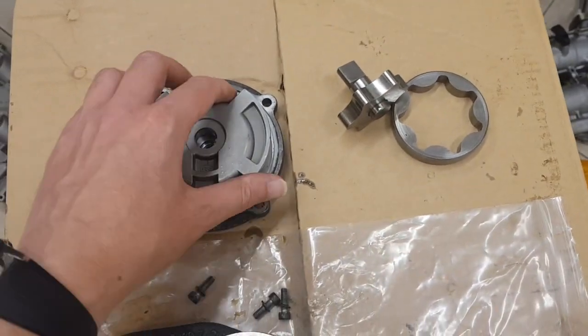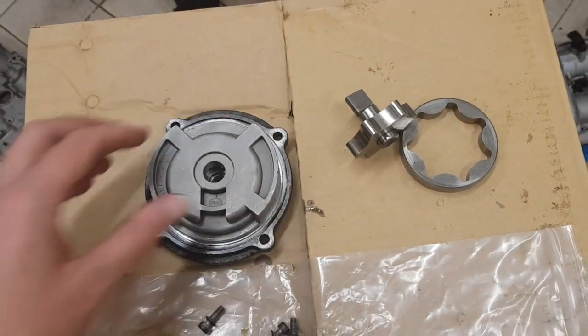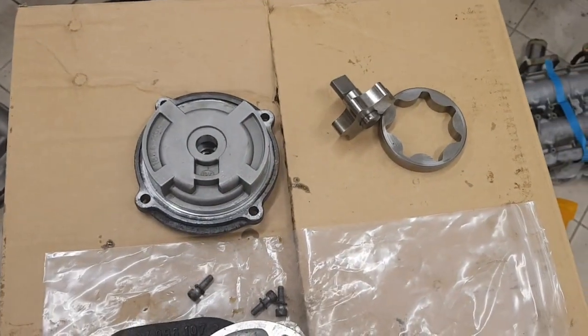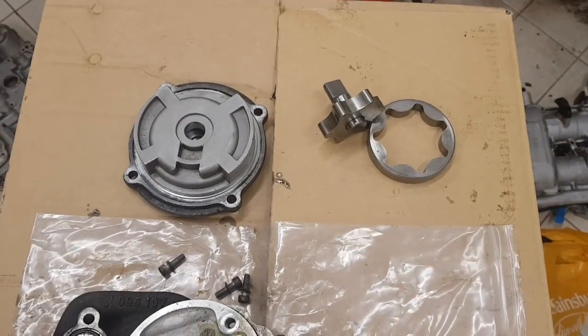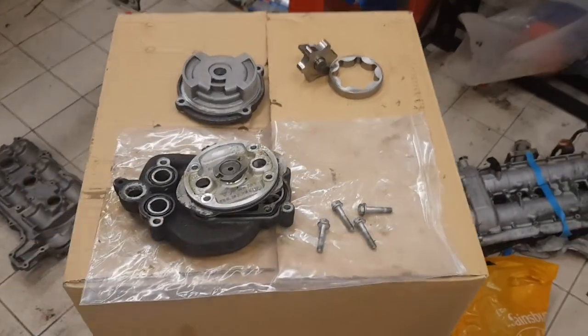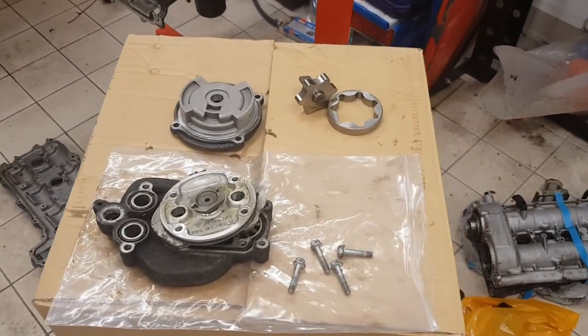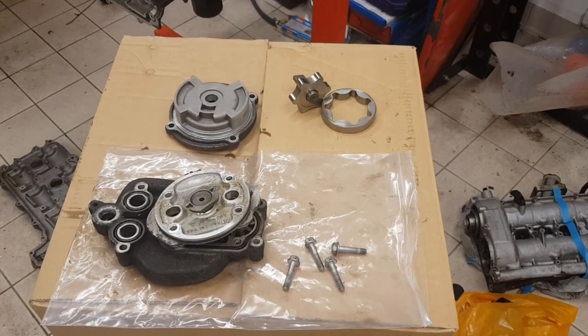So they've gone from three gears, a keyed drive shaft, and four o-rings down to two simple housings and two simple gears — a much simpler, neater design showing clear cost reduction with some nice engineering. Hopefully that's been useful; I'll probably do another video looking at the differences between the other parts of the oil system in the near future. Thanks for watching.